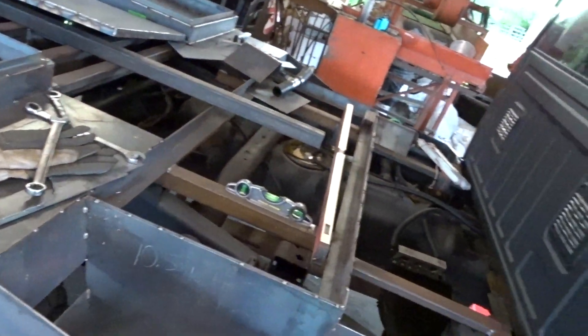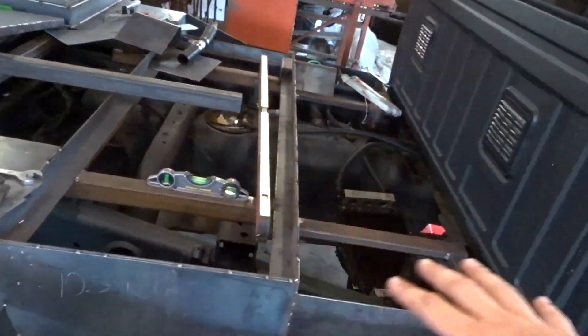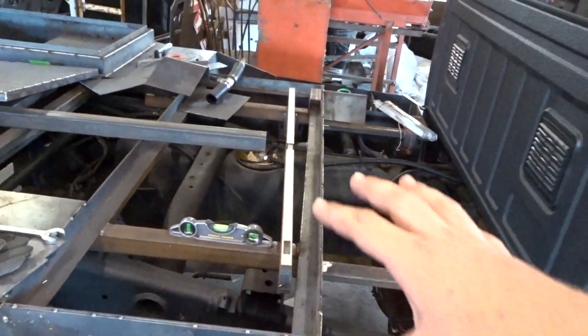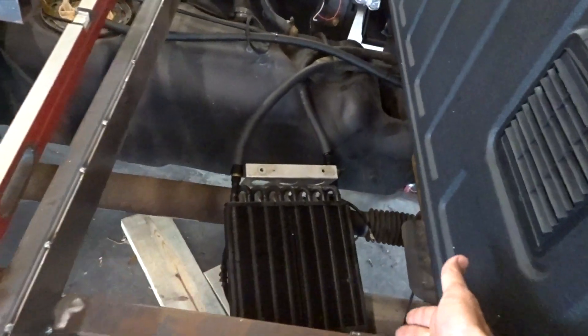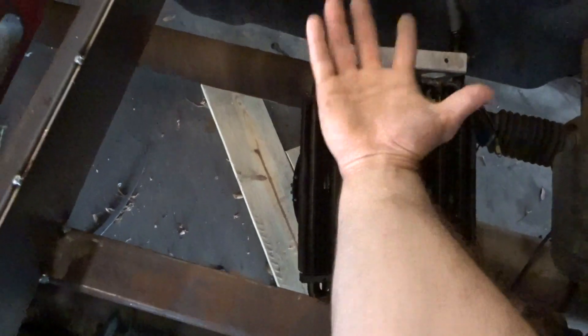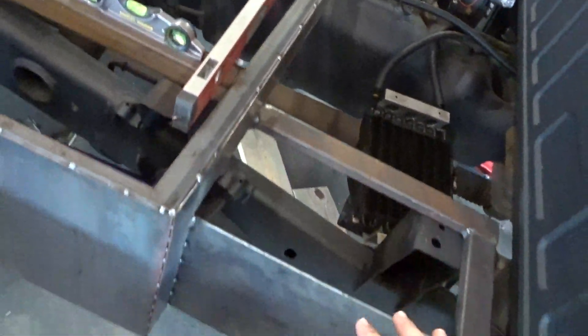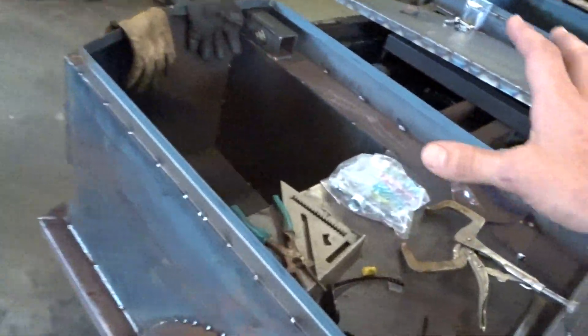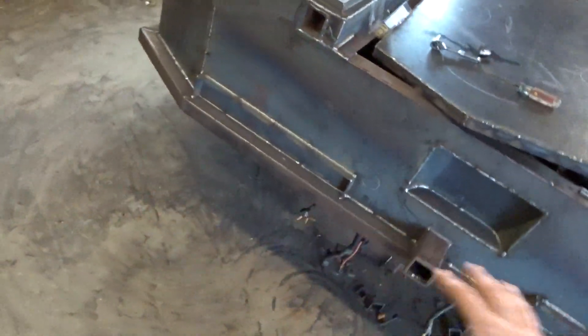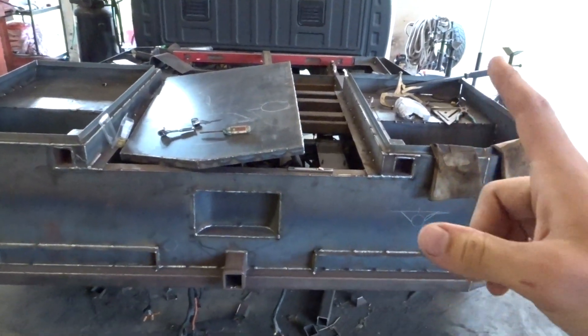First thing — I did get more plate, so it's here, just sitting around back. Tonight I'm going to try to get as much done as I can and wrap this part up. We're going to start with probably putting a brace across here and running some angle iron to bolt this up under here so it has a place to go. I also need to build a downpipe for the exhaust because I don't want exhaust blowing back here on everything. Then we'll try to wind up making the other lid, get some lights wired in, and I just want to get this thing on the road where I can use it.